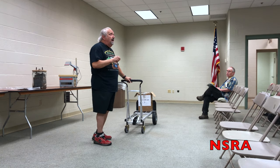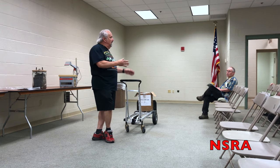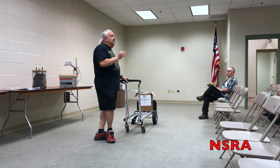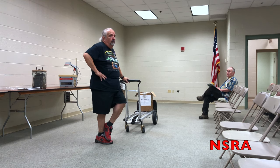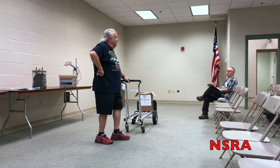And the second thing is, if I'm buying brands, you look for the highest amount of weight. You want the heaviest battery you can buy in whatever class you're buying. It means it's got more lead in it. And let me just tell you how they cost reduce batteries. They make the plates so thin today that their design lasts only a couple, 3 years. The lead plates can wear out, where we never used to have that. Now the plates are so close to each other. So the heavier the battery, the more battery you're getting for your money. Even if you just lift it up, you'll notice it.